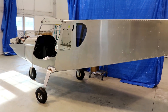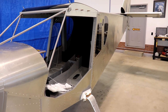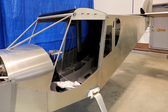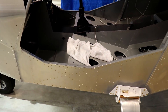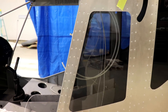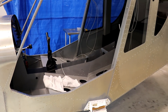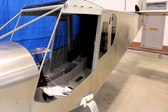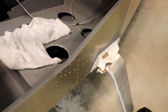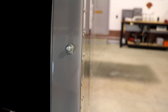Here's the latest status: the wings are now removed. I took the wings off because I need to start building my new doors. If you guys have seen in my builder's log listed on zenithowner.com, I had the fiberglass doors all installed. When I went in to put the latch mechanisms in, nothing fit like it should — everything was binding. The back of the door also kind of stuck out pretty far from the side of the fuselage. The doors fit really nice otherwise, but at that point I decided to go with the new style doors. It was a tough decision because they're not cheap, and also a lot of work — all these rivets along the seal or lip of the fuselage have to be drilled out. This piece has to be unscrewed and taken off.